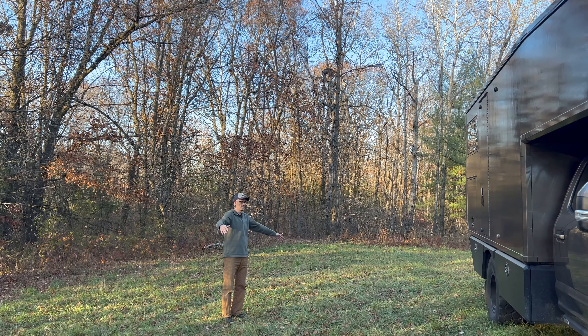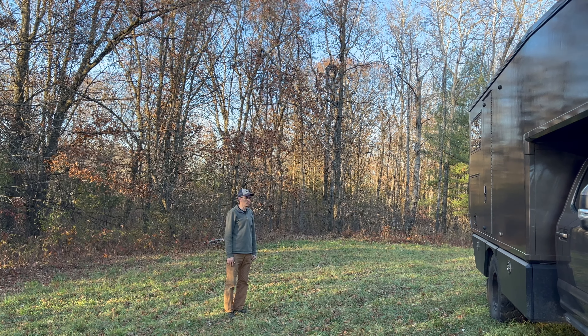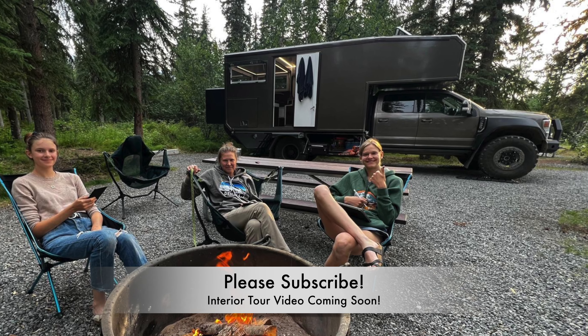This is where we put our shore power — a 50-amp connection, which is overkill; we could probably change this to a 30-amp now that we have some experience. We never plugged in at all on our trip — we had enough solar and enough from the DC-to-DC charger. But this is in the bumper. The power cord goes through the square tube in the back, the 5x5 square tube, then turns the corner, goes down the rail, comes out into that front storage box, and then goes up into the electronics cabinet.